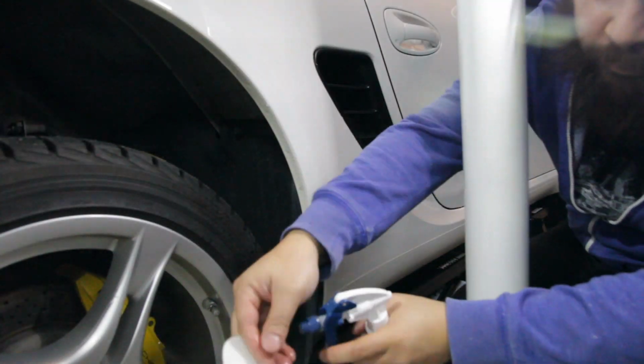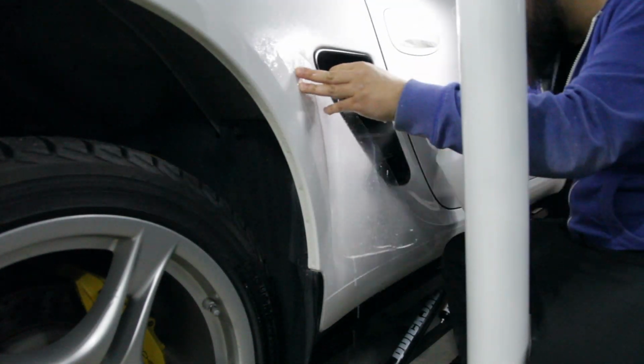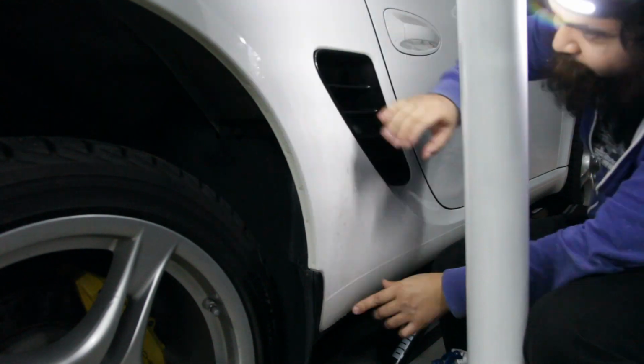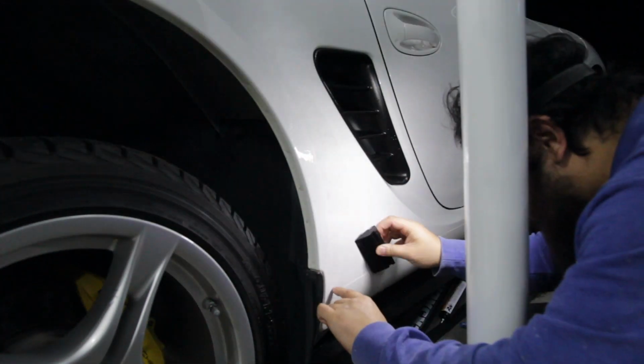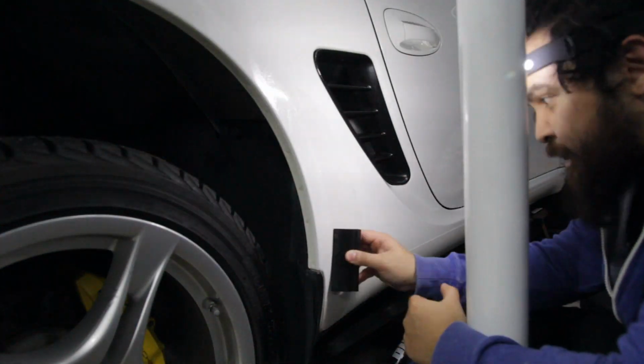Spray your shampoo solution on the panel, film, and fingertips. Start aligning your film. Again, use the transition line to the textured lower area as a base for the bottom of the film. Once your film is in position, lift a corner and tack it down with the alcohol solution. Remember to squeegee from the middle out to avoid creating air pockets.